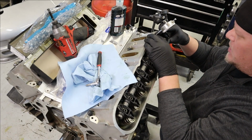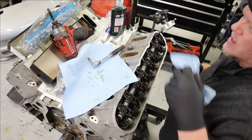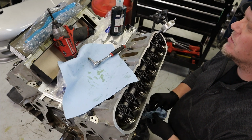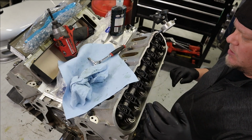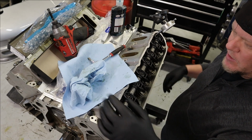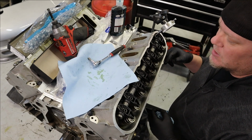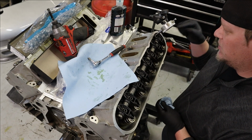And I believe on these applications, that's kind of what you're looking for on an LS7 lifter. I think a lot of builders say 60 to 80 thousandths. Am I saying that right? Yeah, 60 to 80 thousandths. And I've got 100 thousandths now. And so I think that's just about perfect from what a lot of people, some people say run them even further so that there's very little. And I think Richard Holdner, if you subscribe to him, he's a cool guy, and he does tons of tests like this where you run different length push rods just to see how it affects horsepower. So I think this is actually going to be perfect.